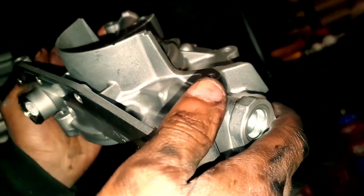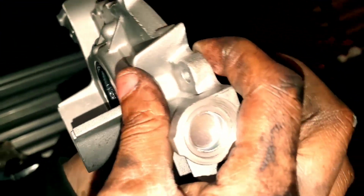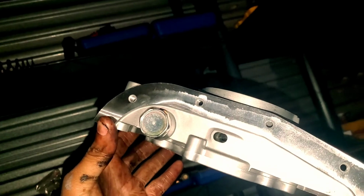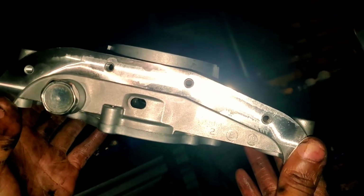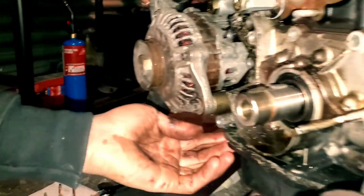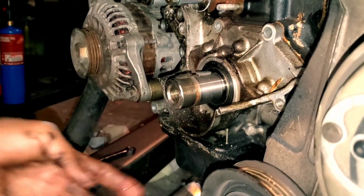And our bolts, yeah. It's 4. We're idiots. That's what's happening. All right, guys. So as you can see, there are 4 bolts on the oil pan that keep this in as well. So it's the 10 millimeters up top, 4 at the bottom. Don't forget that, because then it's not gonna come out. And you're gonna be out here looking stupid. I knew I felt bolts. I was like, God damn it.